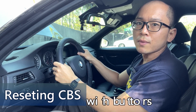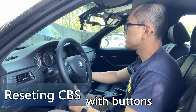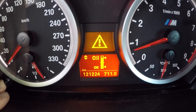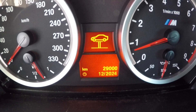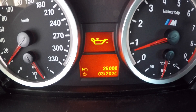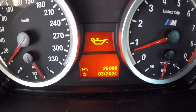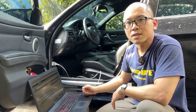You can also reset the CBS reminder just by using the BC button. Switch on the ignition without starting the engine. Press and hold the odometer reset button down until you see the service reminder icon. Scroll down several times until you find the oil service icon. Press the BC button to see the reset option, then hold it until you see the mileage and date for the next oil service. That's all for the engine oil service, but I still have to do the transmission oil service and the rear differential oil service since the car is already jacked up. Please see my next video for more exercises under the car.